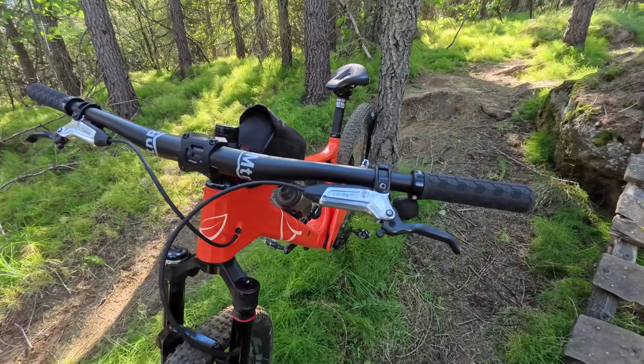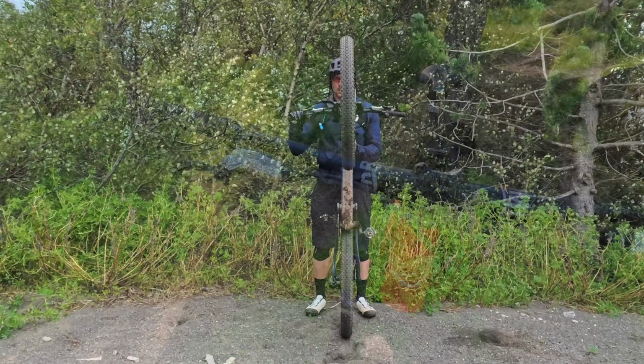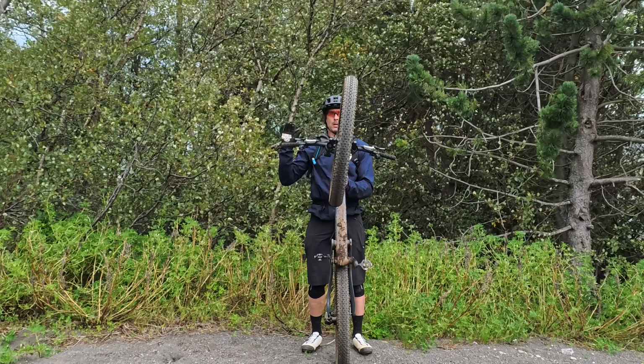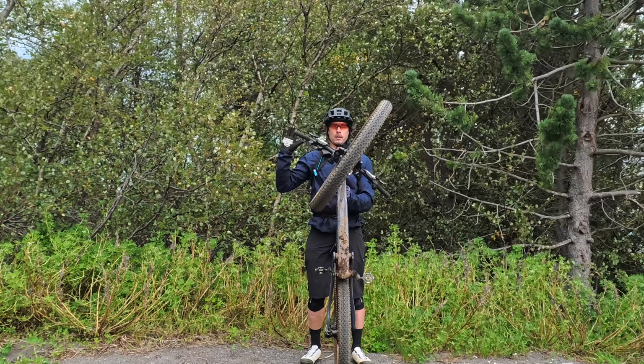Lauf specs their own new 780mm wide riser bar, which weighs just 200 grams. And they spec their damped headset bearings, which help them keep the front wheel stable without adding complex springs or hardware. It's basically just thicker seals and grease. Simple and brilliant.